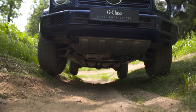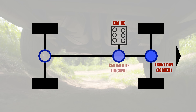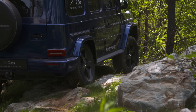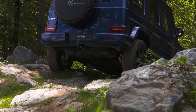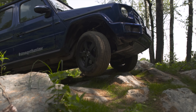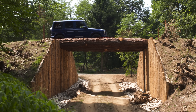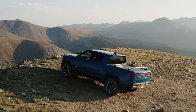So what would be better? How about something like the G-Wagon's approach? Here you have a vehicle with locking front, center, and rear differentials. This forces all of your wheels to rotate at the same speed, which allows for torque to go wherever it's needed — 100% of the torque could go to one wheel if necessary. In the scenario where one wheel lifts up off the ground, no worries, it doesn't get any torque, but the other three wheels get all the torque the engine can supply. So that's as good as it gets for off-road driving — until EVs came along, especially ones like the Rivian R1T.